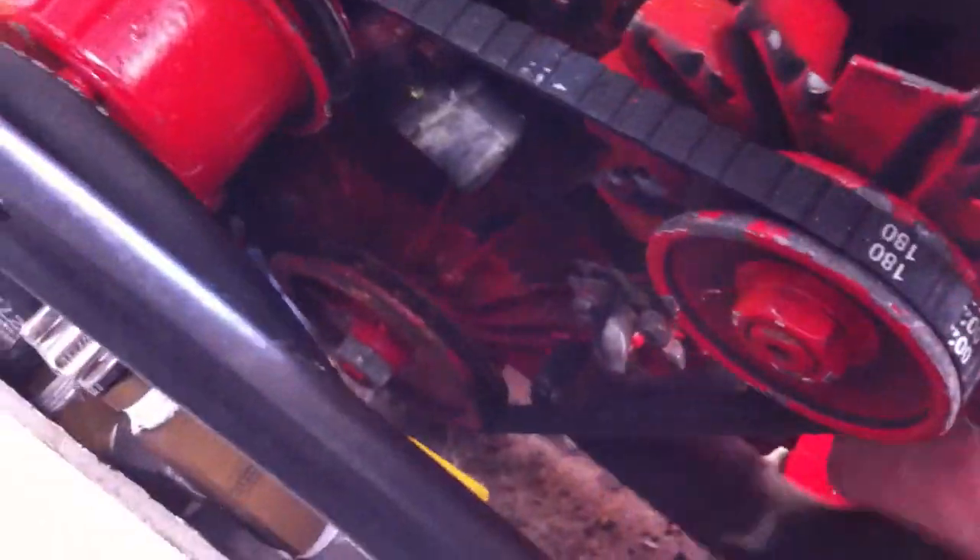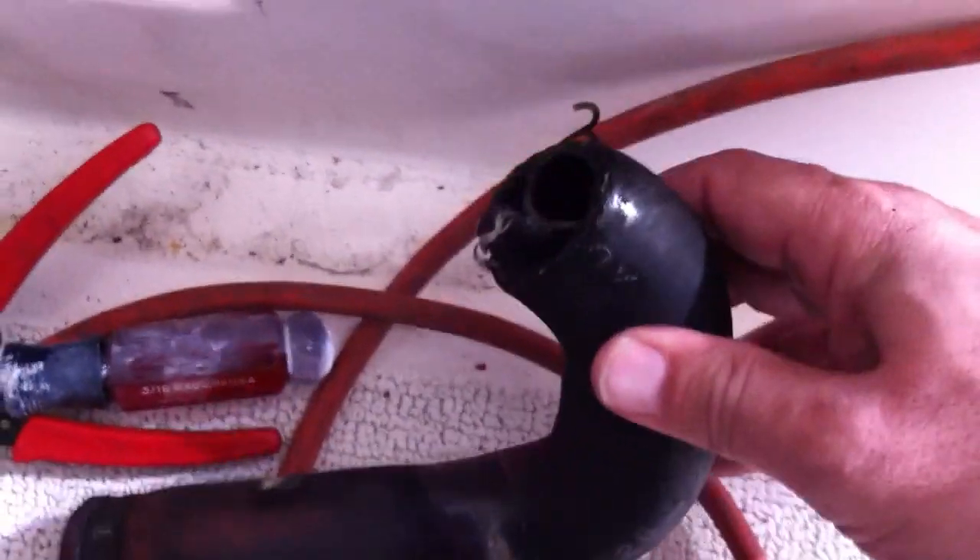You've got to get the hose off the front of the engine that loops all the way back to the heat exchanger. The way to get this hose off is cut it right about here so you can get your hand in and turn it. Use the heat gun to heat this end up, grab hold of this piece right here, you can turn it and get it off pretty easy. First, you have to take this bracket off right here - this bracket is really important, it keeps the hose away from the belt. There's only a quarter inch or eighth of an inch of clearance right down in here, so make sure that's put back together right. I just put it back on so we don't lose the parts.